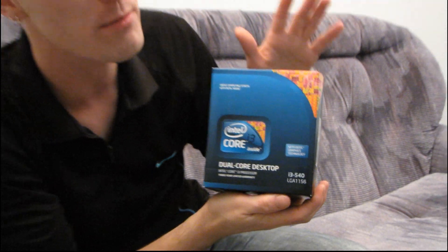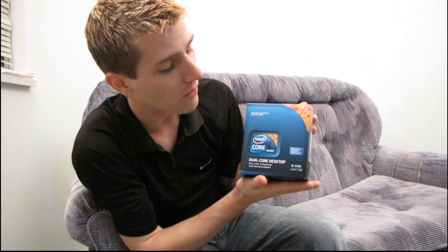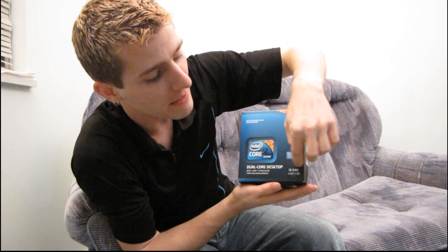...is it's very similar to the Socket 1156 Core i7s and Core i5s with a couple key differences. First of all, an i3 500 series is a dual core processor with hyperthreading. So it has four logical processors, even though it only has two physical processors. This actually provides some real-world benefit in terms of multi-threaded tasks that you're going to be performing, like video editing, stuff like that.